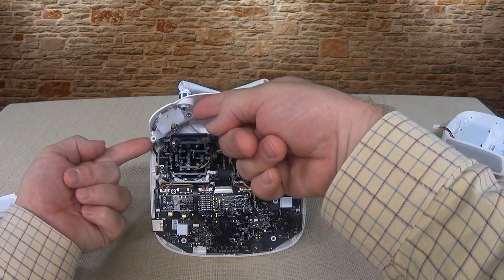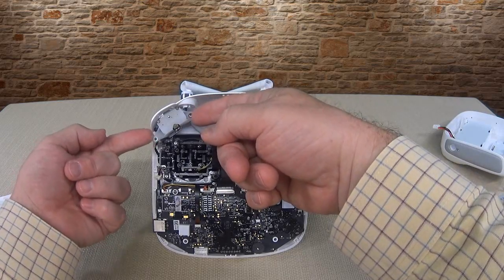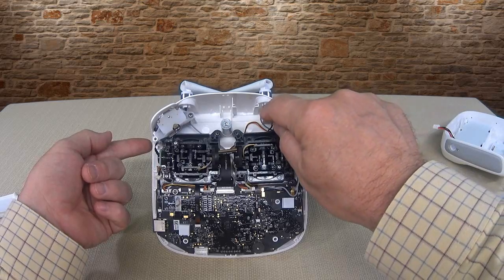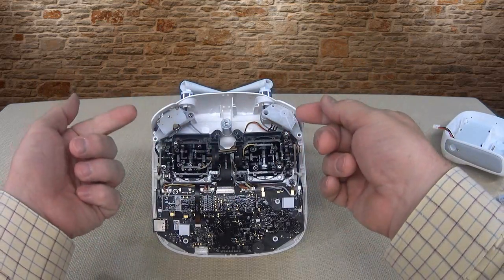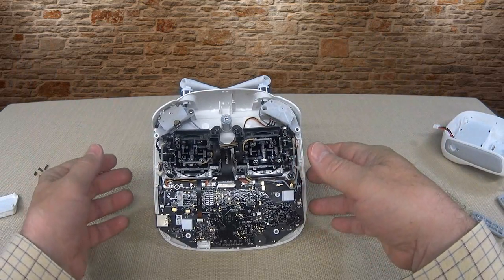And if you look closely at them, you'll see there are two anchor points in the jog wheels. One has a Phillips head screw in it. The other one just kind of goes over the shaft for centering. Same thing on this side. It's over the shaft for centering, and this side holds it in. So essentially what you're doing is pulling these two Phillips head screws out and laying these jog wheels back out of your way.